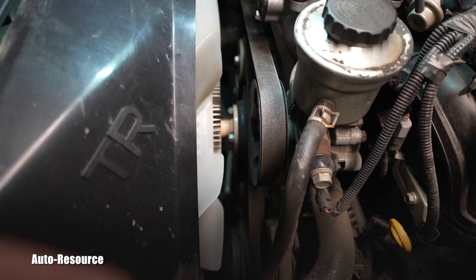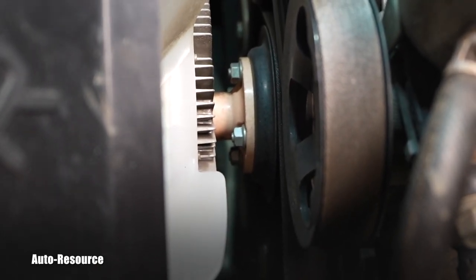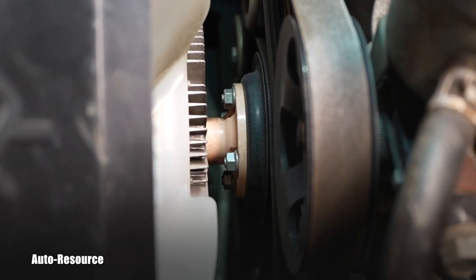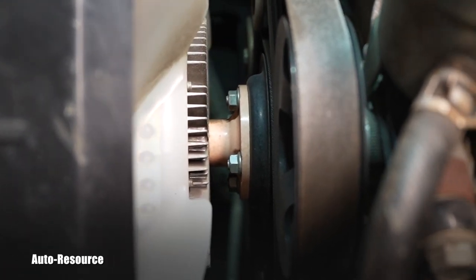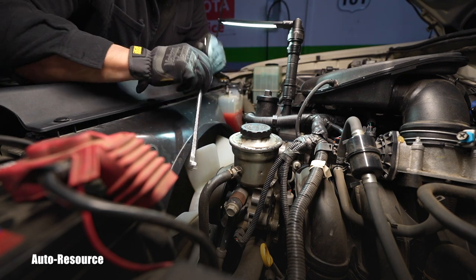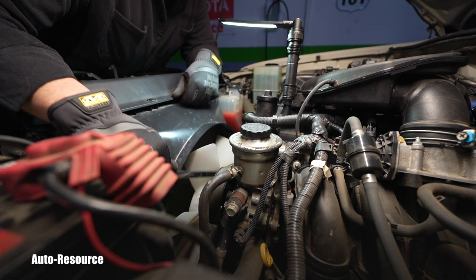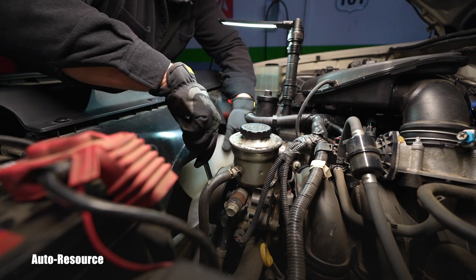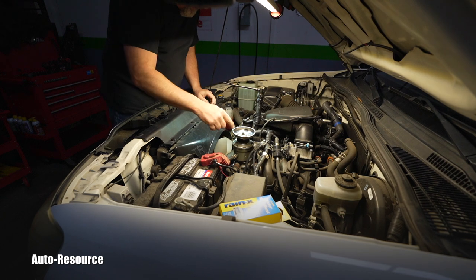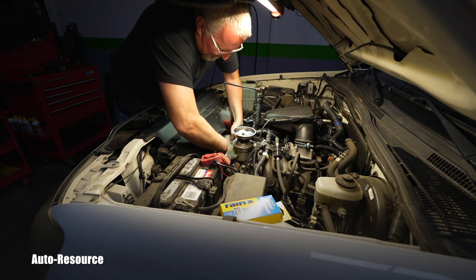It's not very difficult to deal with. You see the shroud and it looks like there's not much space, but that's actually not true. If you look down there, there are four 12-millimeter nuts — that's all I have to loosen to remove that entire unit. On this channel in the past I reviewed the whole set of aviation long wrenches. It's a 12-millimeter — look how easy it is to reach there and crack those nuts loose.